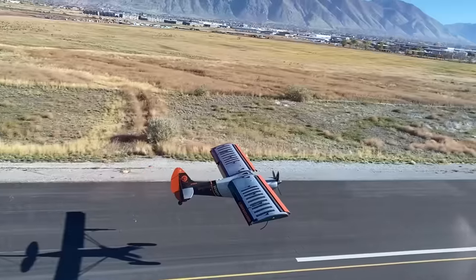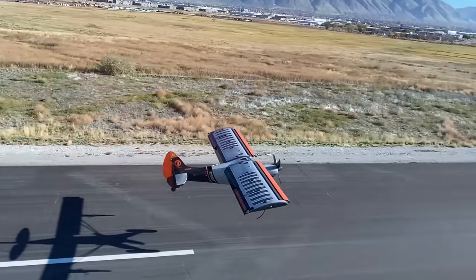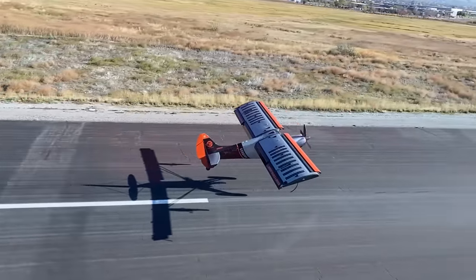As far as how it worked — the plane is flying slower, and we'll get some videos showing it go really slow. Pressure inputs were the other concern. I added so much more aileron in length and in chord that I was a little worried about how heavy the stick would get. The over-center on the front I created to catch the wind and help give me power steering absolutely worked perfectly. I can't tell any difference even though I have a much larger, longer aileron now. The forces feel exactly the same at all speeds. I couldn't be happier with that.